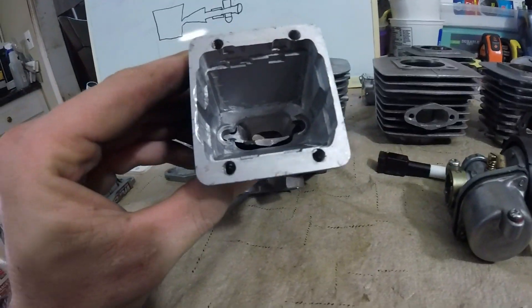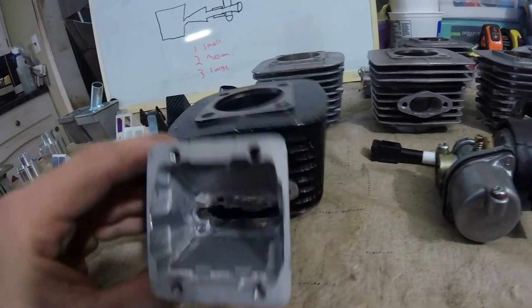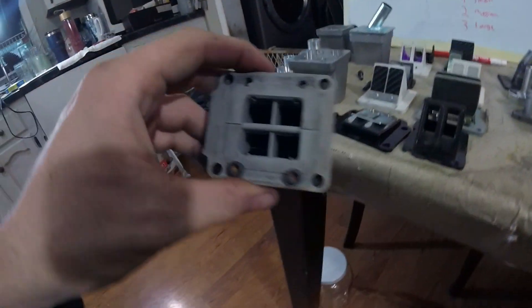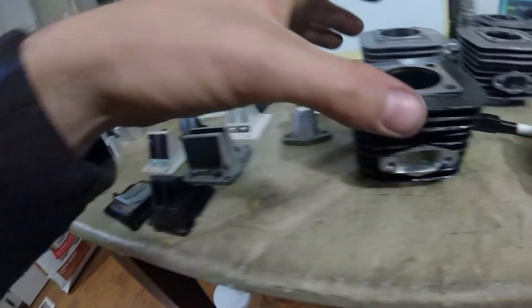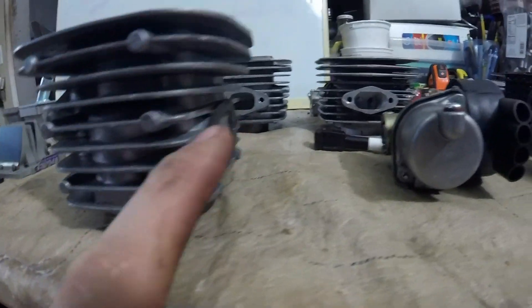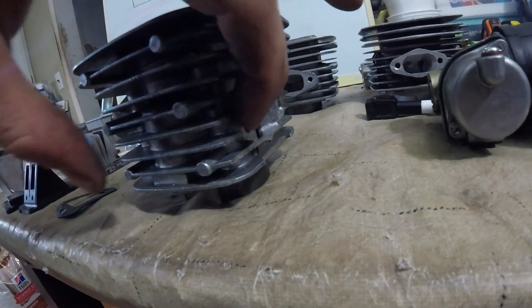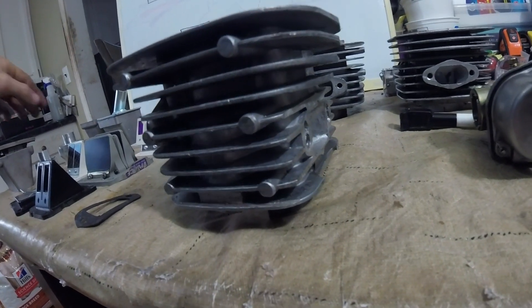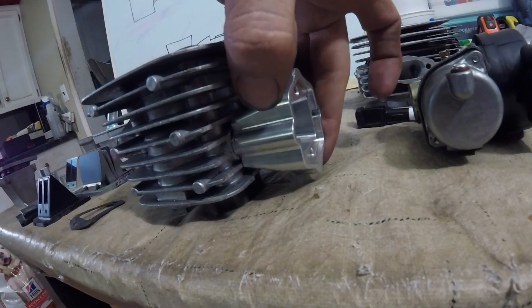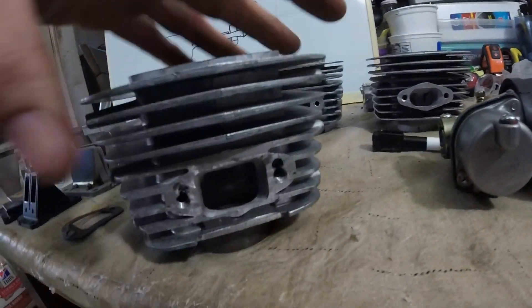I matched the box to the port, as you can see, to allow quite a bit of flow for a decent sized carburetor, and it's also a gigantic reed valve. So we've got a large port here — this is custom. I actually milled down the intake to a much flatter surface than stock so I could fit this OZ reed closer to the intake, and I shaved the intake of the OZ reed down to tighten up the system and reduce volume in the intake track.